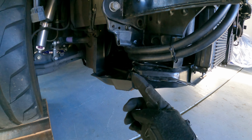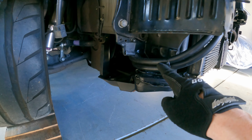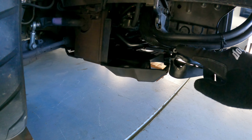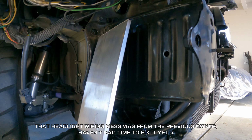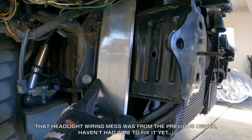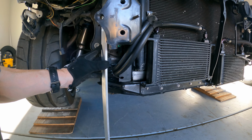A few weeks ago I made some modifications to the radiator support to allow the aluminum uprights I'm using to mount at a perfect 90-degree angle to the splitter. I also rerouted the transmission cooler lines and oil cooler lines on the opposite side, so if I went off track and the mount twisted or broke, it wouldn't compromise the lines by tearing them.